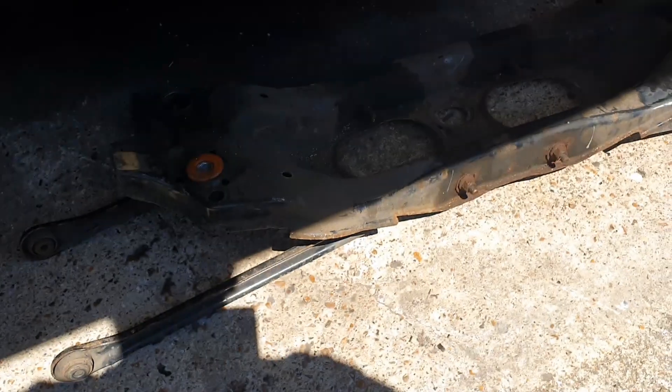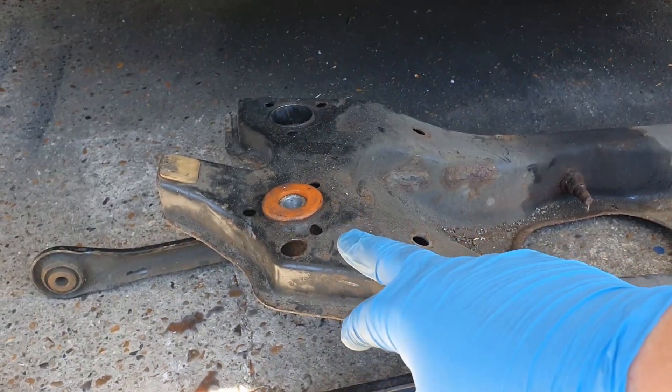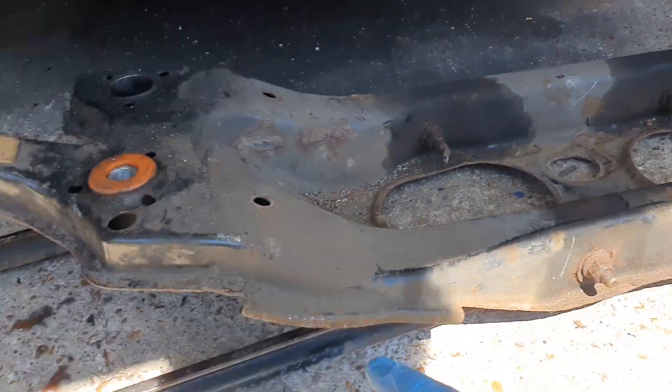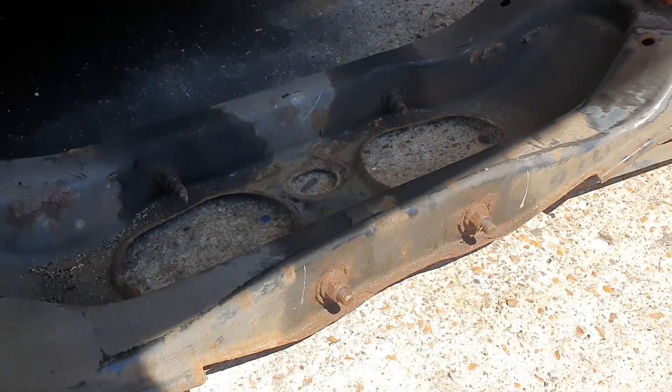So this is what the subframe looks like at the moment. I'm going to get the poly bushes out and I've started sanding it back with the angle grinder to get rid of a lot of the rust. I'm going to replace the arms on both sides and get new bolts through it as well. Let me know what you guys would do — carry on refurbing it, get rid of as much rust as possible, treat it and spray it back up? The next video in a couple of weeks will be the ST video.